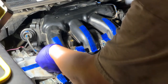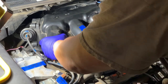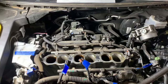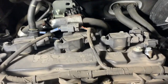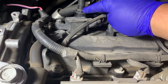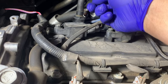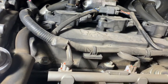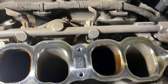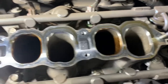All right, let's pull this plenum off and see about changing some spark plugs. Here we go. And there it is. All right, so now you have access to those three coils back there, and here's those infamous tubes right here. There's the PCV valve. There's the bracket that was holding up to the back of the air intake, and this is the one that runs up against the firewall. I think it's the brake booster. I guess I need to cover that air intake, so I'll maybe wipe it down, clean it off pretty good, and then put some papers over it so stuff won't fall into it.